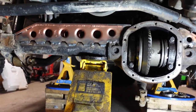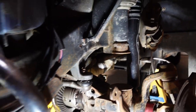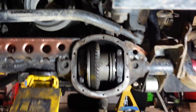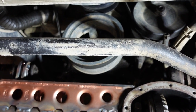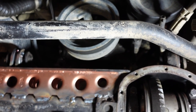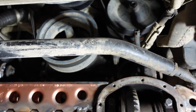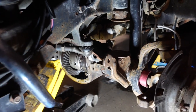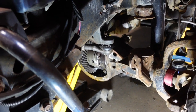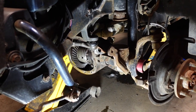If you've been watching this video series you know we had a problem with the axle coming up and hitting the exhaust in the back. But I didn't calculate that when I put the truss on you're adding about two inches, and I'm not even at the bump stops yet. Part of the oil pan and the crank pulley could come crashing down right onto the axle truss — where before it didn't matter. I do believe I went with four-and-a-half-inch springs for the front as well, so that might compensate some for the compression if I hit a big bump, but still it's not looking good.